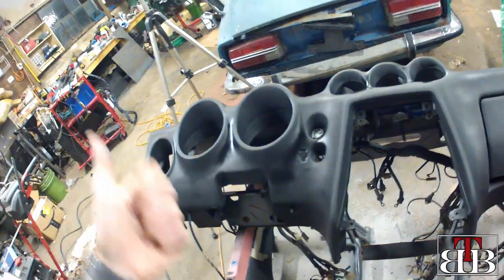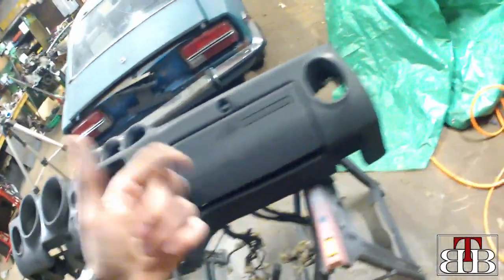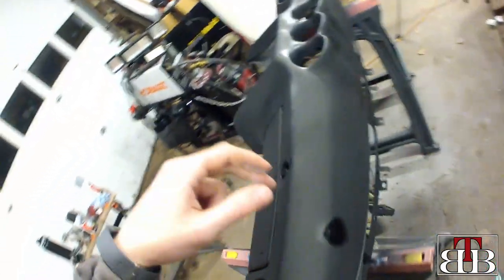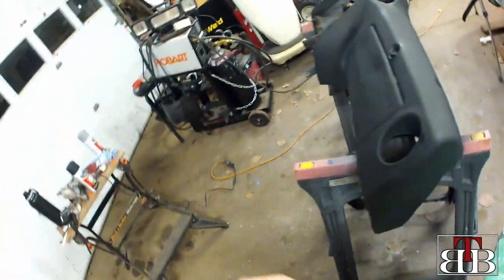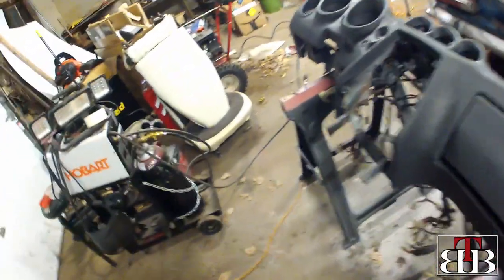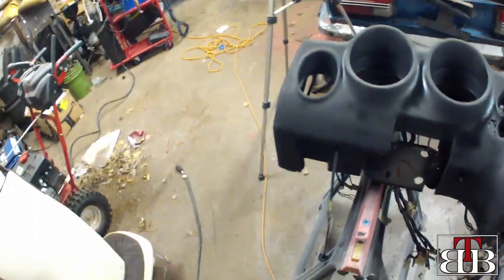Our concerns are it's structurally sound and it's ready to be flocked. I've got a few more hours before I can throw some glue on this thing. I need to wait for some wetter areas — areas that needed more primer to get full coverage — to set up. Typically two to four hours. It's actually fairly warm in here tonight, it's 62 degrees.